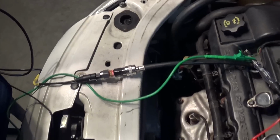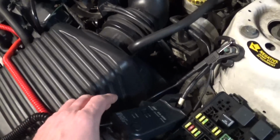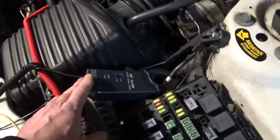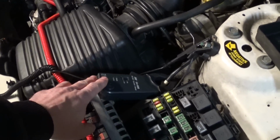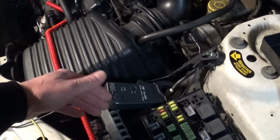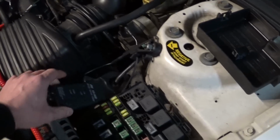The last one is going to be the red channel, and that's going to be my high current clamp. So that's what we're going to do first. One more thing before I forget: when you start doing this, if the signal from the current clamp is negative, you just invert it. I'll show you this. So just turn your clamp over.